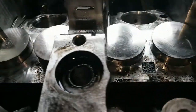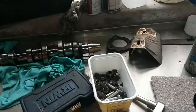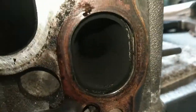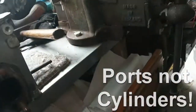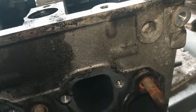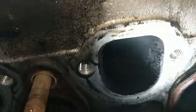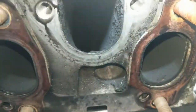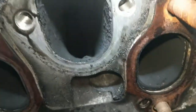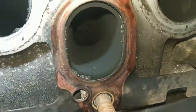There's minor scoring starting on those, so I may just put some buckets in. I'm going to inspect the camshaft a little bit later on. Let's have a look at what the internal cylinders look like - let's grab a torch and get to work. As you can see, that's fairly coked up - that's an inlet, and that's an exhaust.